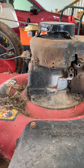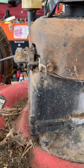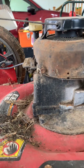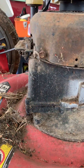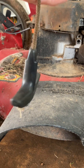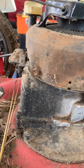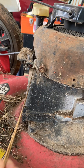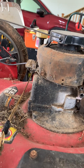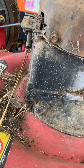The cable is rusted, the engine brake is on, and the kill switch is engaged, so the spark plug is not going to get any spark. To test if it has compression, I get the spring off using an old pull cord handle, a bit of string, and a very stiff wire — hooking it around the back of that spring. Now I'm going to pull this way and down, and that really stiff spring is off.